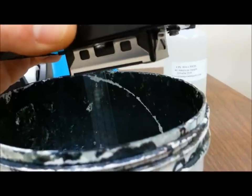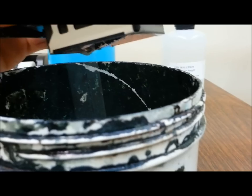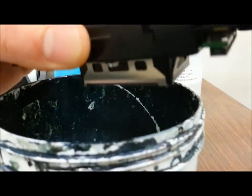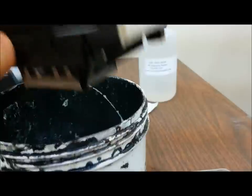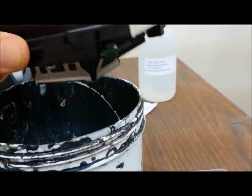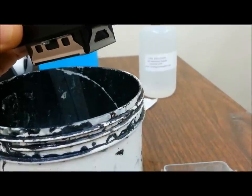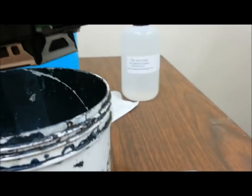Right now I'm using a printhead that has been waterfalled previously, so as you can see the stream is nice and even. Use about a half syringe full and move on to the next printhead nib, repeating the step. If you run out of cleaning solution, just grab some more from the cup and proceed.